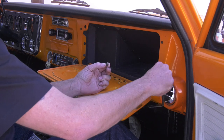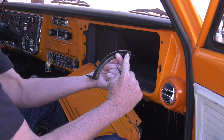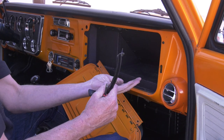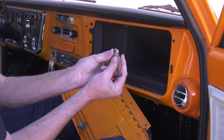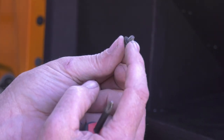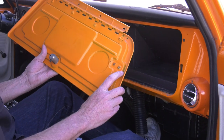Note that this right here is the stop for the glove box, and that's how it comes out — it may also have a little rubber stop on the end. These screws for the stop are going to be different from the rest of the screws. The most numerous screws hold the glove box along the perimeter and on the hinge, but these two are specific just for your glove box stop, so don't get them confused.